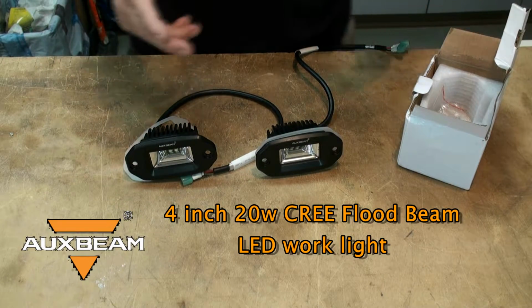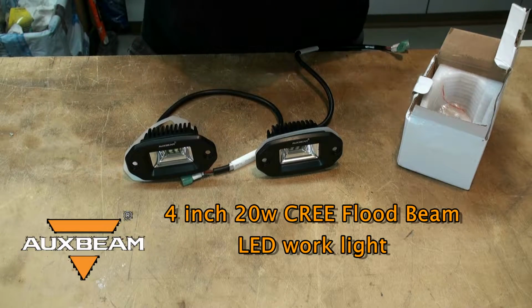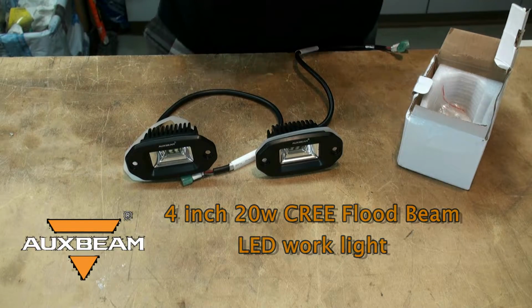And they sent me a harness with a switch, which I don't need because I found something else out that I didn't know. Did you know that 7-pin plugs on your pickup truck going to your trailer, the center pin is hooked up to your reverse lights? Why? There's no reverse lights on trailers. Why do they have it in there? But it's good. I'm happy they do it because this is going to make my job really easy.